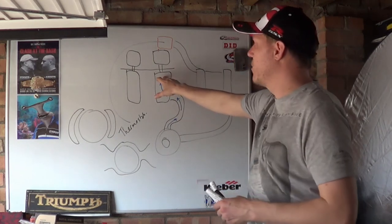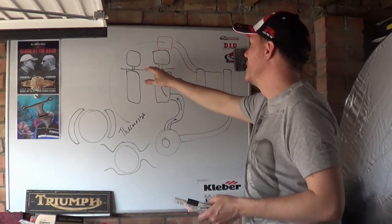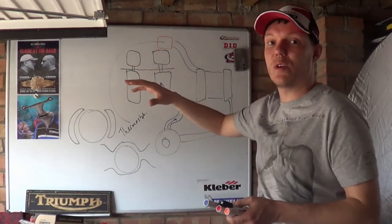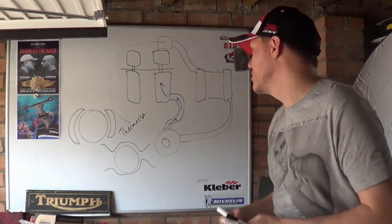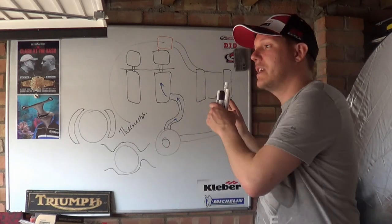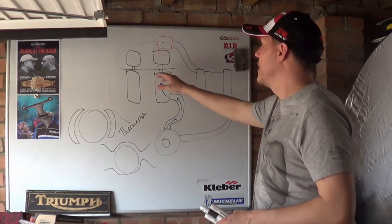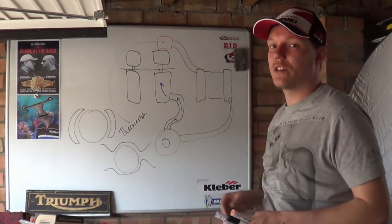So what we do is we have our water jacket, and this absorbs any of the excess heat that we need to get rid of for the next stroke to come along, and then obviously it goes into your head. It cools there because in your head, for a four stroke or a two stroke, that's very close to where the combustion process happens in your combustion chamber. Not only that, with four strokes it's more important because we have exhaust ports, and that is one of the hottest sections of the engine. So we have these voids in your head for cooling. Generally there are larger coolant passages on your exhaust side than on your inlet side, because your inlet basically acts as a cooler anyway, because of cold air being drawn in. And so generally your intake side is cooler than your exhaust side for obvious reasons.